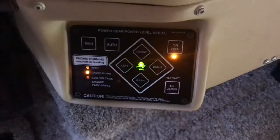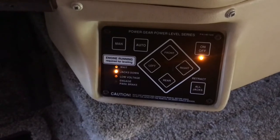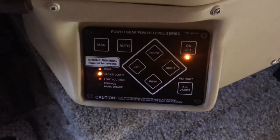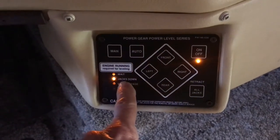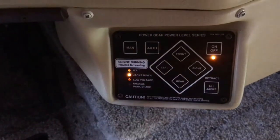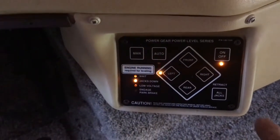I got all the slide outs pulled in, still got three jacks down on the ground, I've got to pull them up. First, crank on, cranking the engine, turn that on, sets the jacks down level. You don't see anything about the one being blown out, but we're going to pull up all the jacks — they're all up. My light for my jacks down is still on because I don't have enough fluid in my reservoir, because one of my hoses blew out and I've got fluid on the ground. So we're going to take care of that now, pull that hose loose, turn that off.